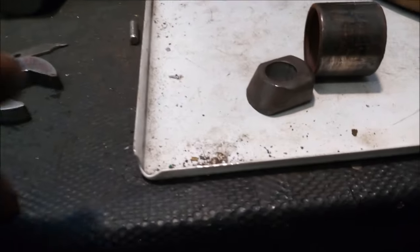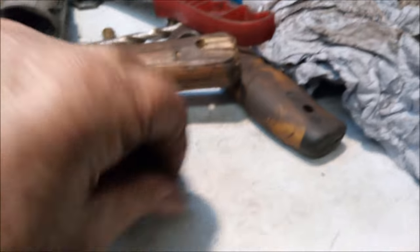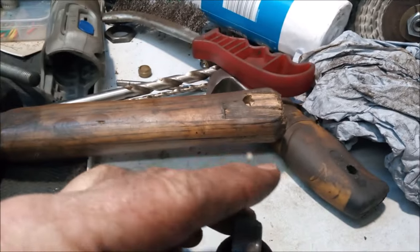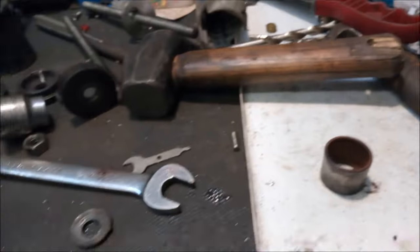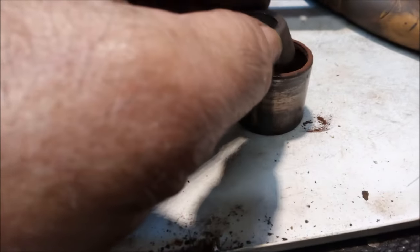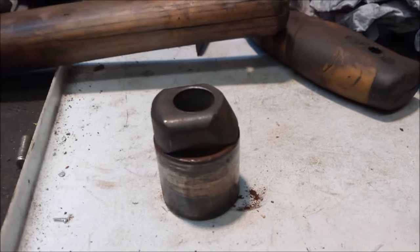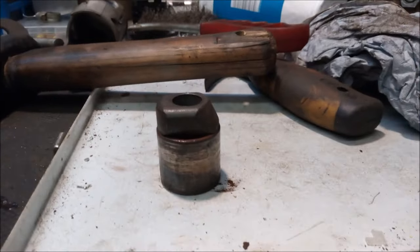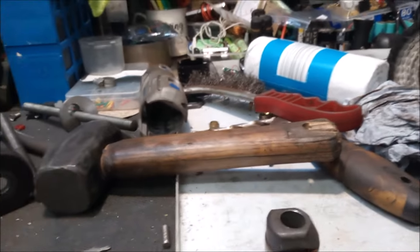All right, well, this is part of the tool set for getting out the roller bearings, because what I can do, you get the end of it and you drop it down through and it goes right the way through. Normally does anyway, apart from when you're filming it. Oh, so it falls on the floor miles away, joins the 10mm spanners. But what happens is when you push it round inside, you can actually turn it round, and then it's facing the needle roller bearing, and then the bolt goes in the far side and you just pull it out.